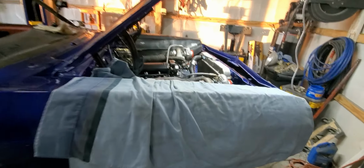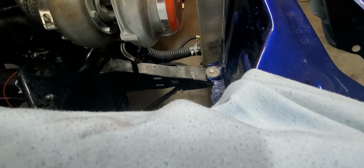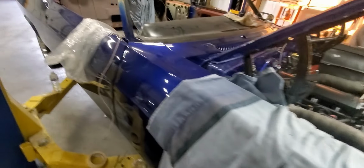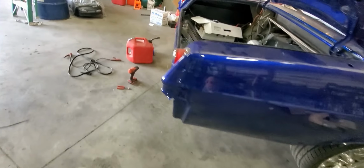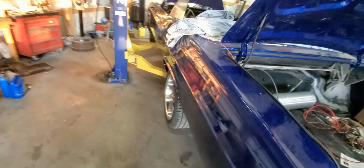We're getting ready to put water and tranny fluid in it. Got our radiator hose finally down there, and we looped our heater hoses. In the back we worked on the fuel pump, and we got it grounded, and for now we've got the wire that signals the fuel pump just running over the top of the car.